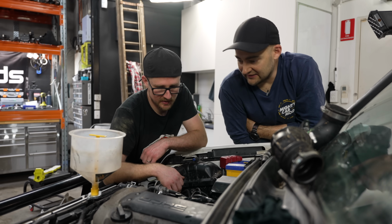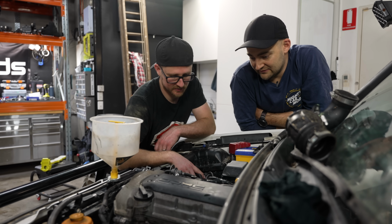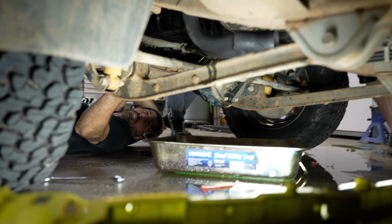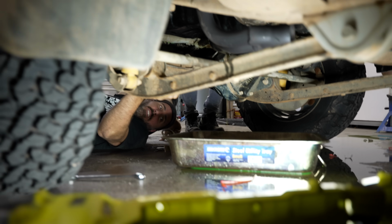So where's it getting supplied from though? The intake manifold is really the only option. So then it's got to be a cracked block. Yeah. That's like a hole in a block though. We didn't see that when we poked around in the sump yesterday. Couldn't the head gasket be catastrophically blown as well?